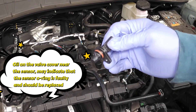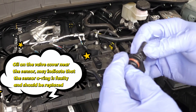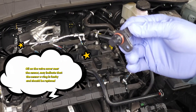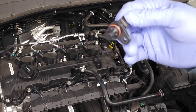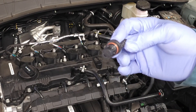If there was oil around the place where this is installed, you want to consider replacing the O-ring. You can find a multi-pack of O-rings on the internet fairly easily or at your local parts store. They should be heat and oil resistant. So you could replace the O-ring without replacing the entire sensor.